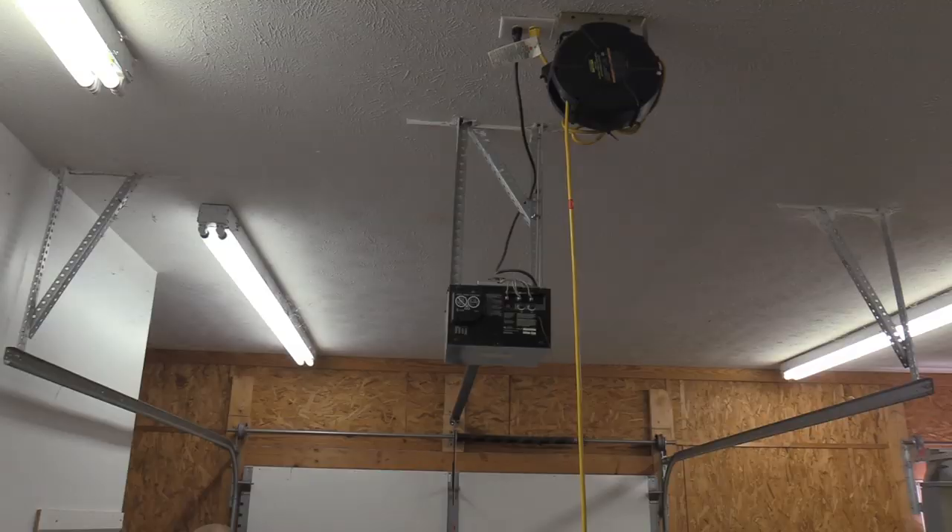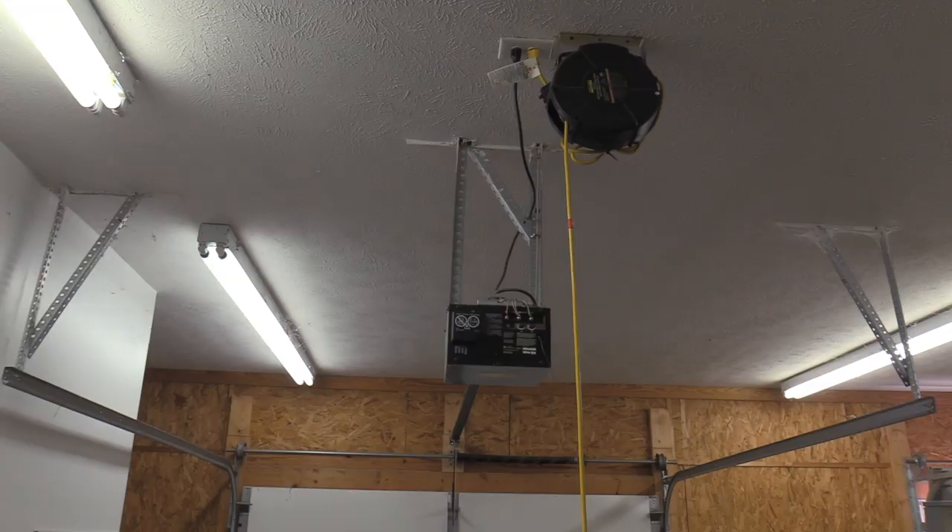Another thing to deal with is hang-down from the ceiling. Your ceiling height may be nine feet, but if you've got a garage door with opener tracks, overhead lights, or a reel for your power outlet like we have, all those things have to be taken into account. You don't want to wreck the roof of your car when you put it on the lift and raise it up in the air. Some of this stuff is going to be a pretty heavy additional expense if you have to make changes to fit the lift into the garage bay.